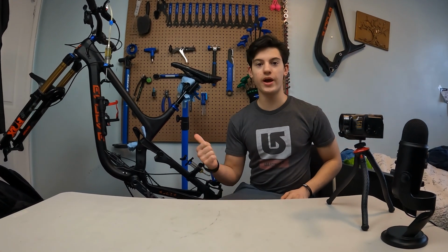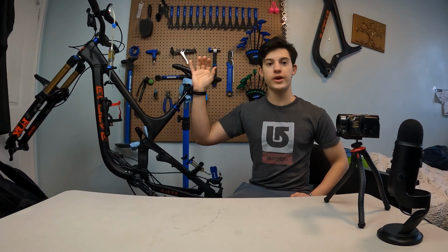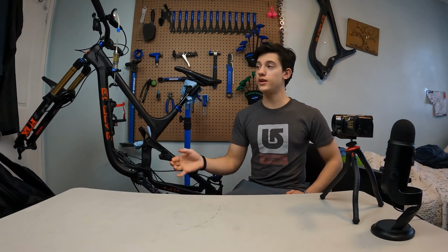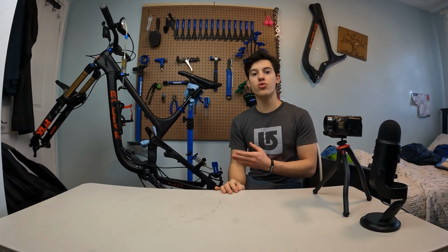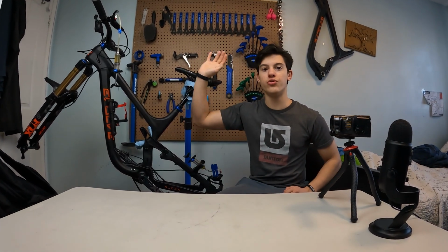Alright, so I just took a little break at school and now I'm back home and ready to finish this job. So now that we're sure there are no air bubbles coming out of the system, we can start closing the system a little bit and getting off those syringes. So the order is to start with the caliper one, and then we're gonna finish with the lever one.